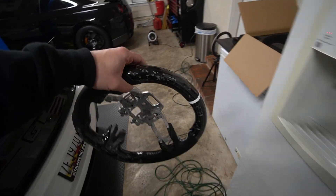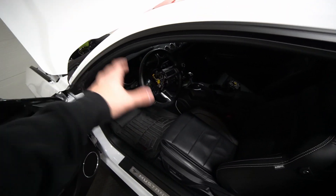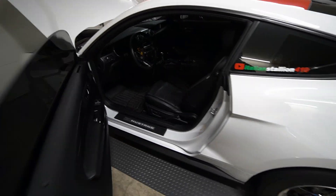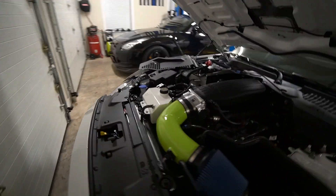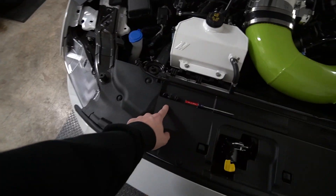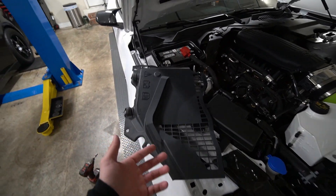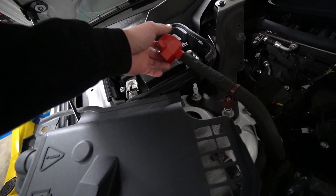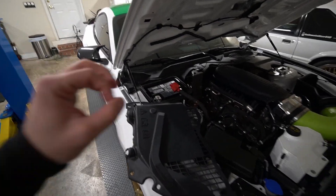But once she is on it is going to be so much worth it. Now let me get you up to speed on every little thing I did. First thing you have to do is disconnect the battery — pop your hood. There are a few clips, I think three total, you can just slide this piece off to the side if you have a hood strut. I took my positive cable off — easiest one for me to get to — took it off, slid it to the side so it won't be able to touch anything. First step complete.